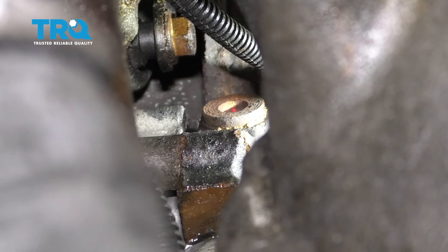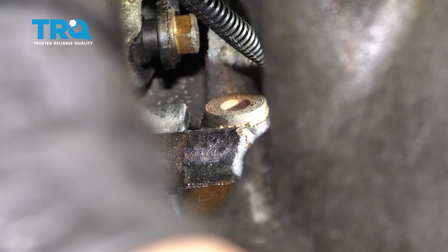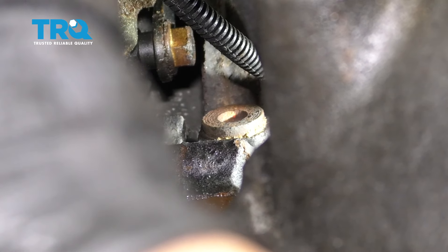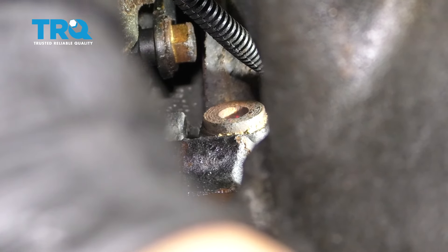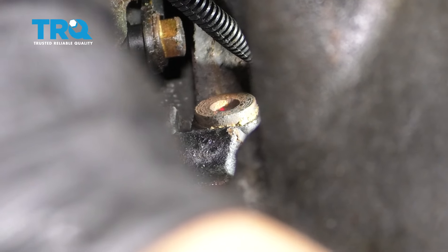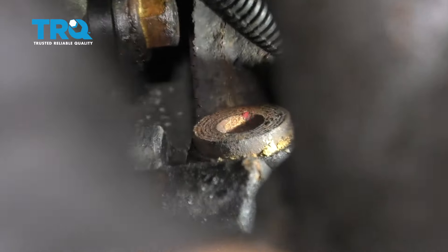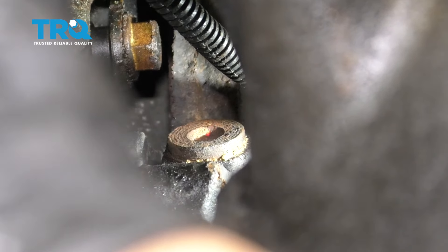On the side of the block, there is a plug right here — that's gonna feed to the oil pump itself. After you're at this point when you put the oil pan on and the oil filter on, what you could do is fill up the engine with oil and then take that plug out and actually prime the pump right there. We put oil in the pump before so we should be all right. The preferred way to do it is to put oil in that plug and let it prime for about half an hour, letting oil drain in to help with priming it. But we should be okay with how we did it.